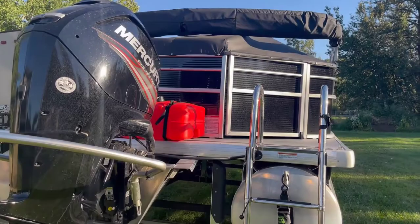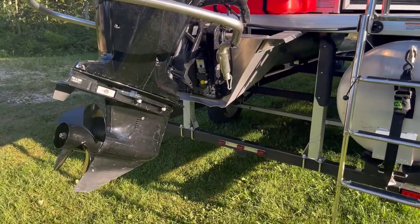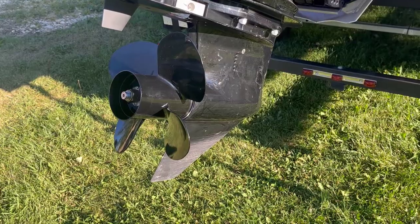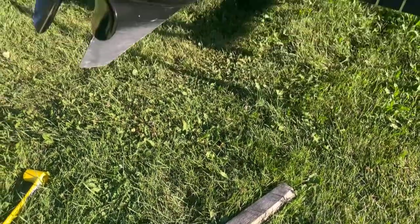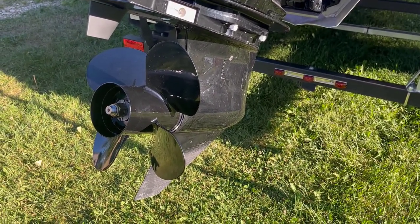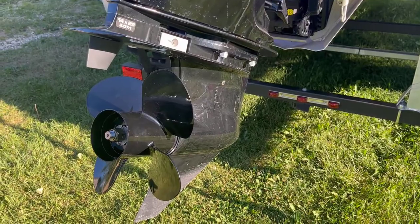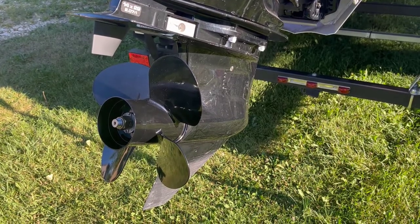That's how we're going to work on our little Mercury 75 four-stroke. I anticipate that going to this 14 by 13 pitch is going to reduce my RPMs a little bit. When I'm maxed out right now, I'm running at about 5,500 RPMs using the old approximately 14 by 11 prop. So when this 14 by 13 is on, I think it's going to be probably in the neighborhood of 5,000 to 5,200. From all the research I've done, that 5,000 mark is kind of a good number — we don't want to go too far below that because the engine's lugging, not getting the coolant flow. Running full out, we're probably going to be sitting at around 5,200 RPM.